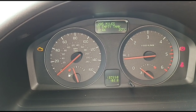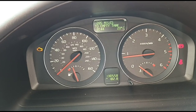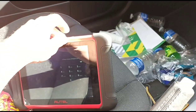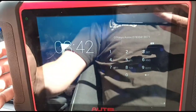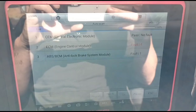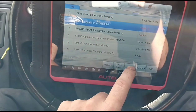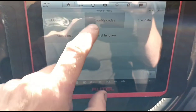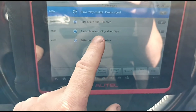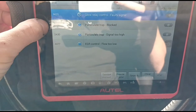We've got plenty of diesel which is good. We've got the diagnostics plugged in, so I'll switch it on and go through the car. We'll do an automatic selection and read the VIN. There's a bit of glare on the screen but we have four faults: glow relay faulty signal, particle filter blocked, particle filter too high, and EGR valve flow too low.